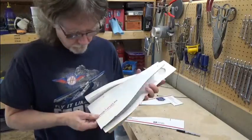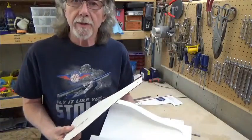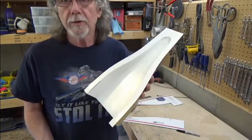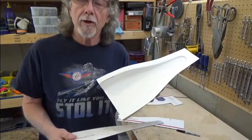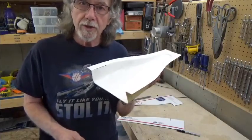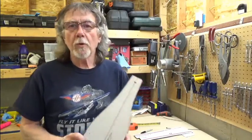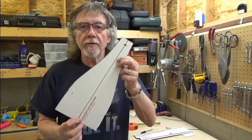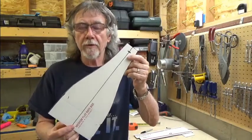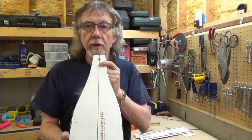As you can see it's not a bad fit. The next step is to determine the position of the inlet on top of the cowl. We'll need to take off the cowl, create a center line, and replicate that center line on top of the engine. One more reminder: be sure to draw a center line on the template, and when you place it on the cowling — since you already have your center line drawn on the top cowl — just line this up and you'll be set.